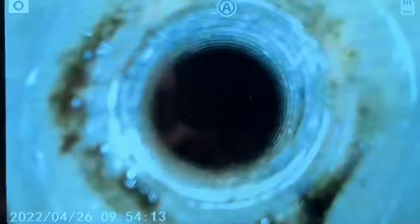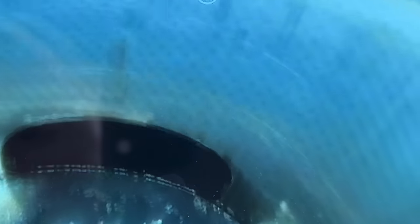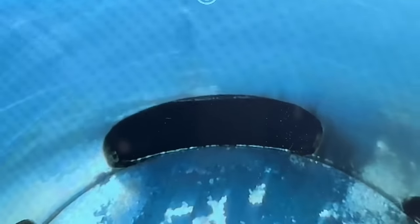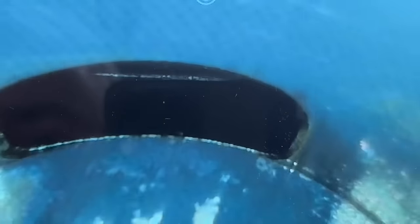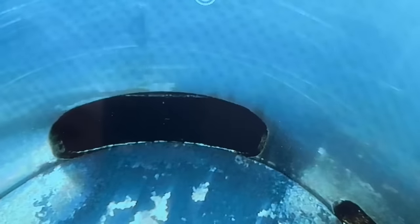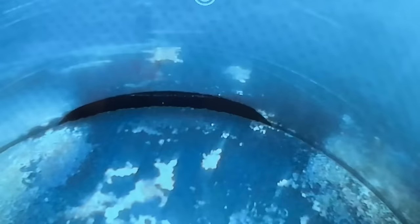Okay, I've got this chainsaw bent over, ready for inspection. Here you're seeing some carbon buildup on top of the piston. The cylinder walls, those sideways marks, that's factory cross-hatching. That's supposed to be there. It's kind of hard to see, but on the cylinder walls, you can see a little bit of up and down scoring. That's some very light scoring. If they would have continued to push this saw and try to make it work by feathering, they eventually would have destroyed the piston and cylinder in this.